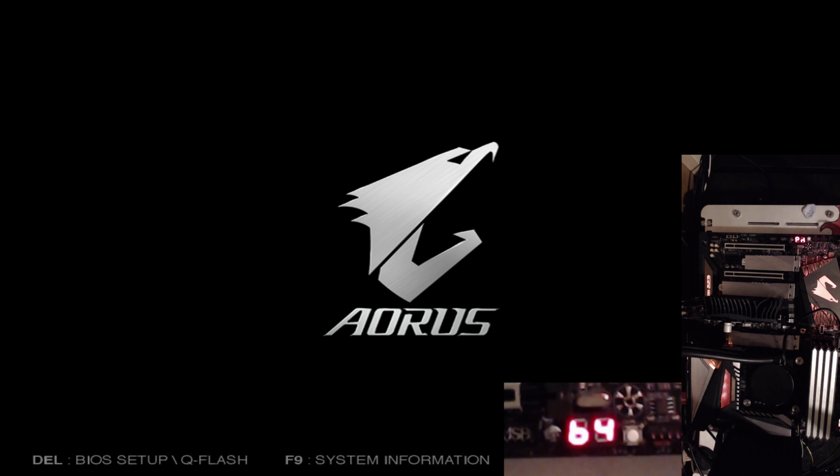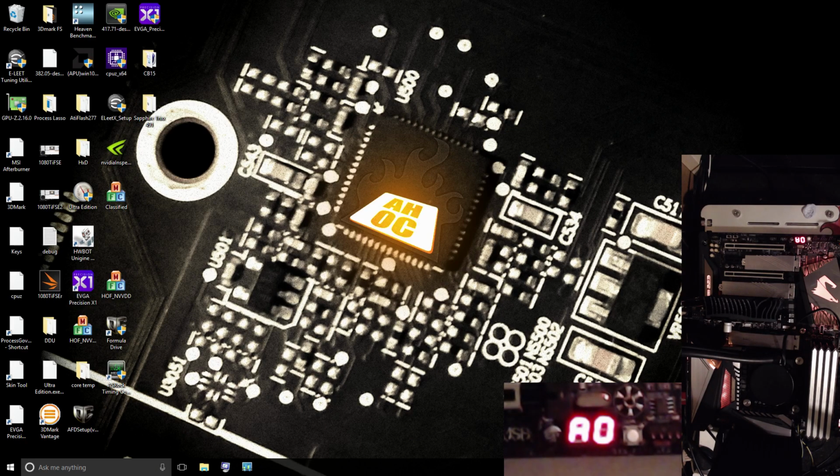Restart. So the thing about the termination resistances is I'm not sure that what I've configured here is necessarily the best for everything everywhere, because the termination resistances, in theory, will depend on your motherboard, somewhat on your CPU, and somewhat on your memory sticks. Like what is optimal. So if you're messing with your own system, you can just try the numbers I tried of 60, 60, 120, 120, 40, 40. But if those don't work, I would recommend that you just see what the motherboard sets at frequencies where it trains normally. So at like 4,000 megahertz, just see what it defaults to on its own and just copy that. Because that's where I got my 60, 60, 120, 40, 40. That's where I got my settings from. Is just seeing what the motherboard used up until it stopped working, and just went with that.